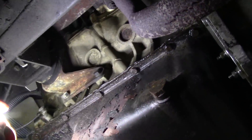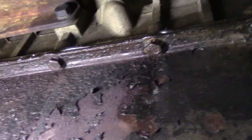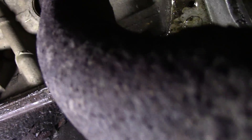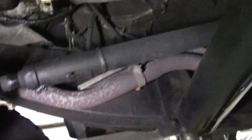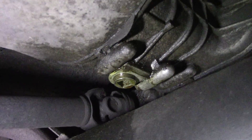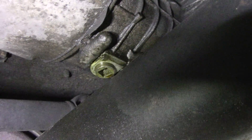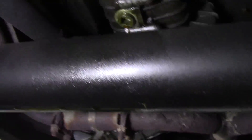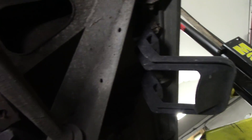It's had a silicone finish on there — I'm not sure if that should be silicone or a gasket. These early oil pans weren't very rigid on the bolts. I'm going to get my half-inch drive and try to tighten those up because it might just be weepy out of there, or the two bolts on the side. It has been dripping down there because you can see all the oil. The front outriggers are good.